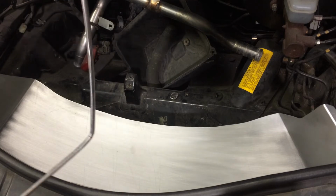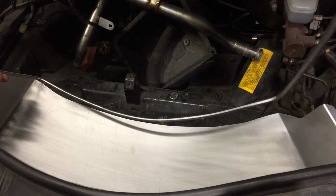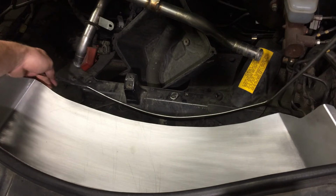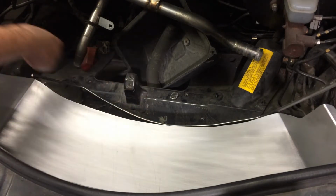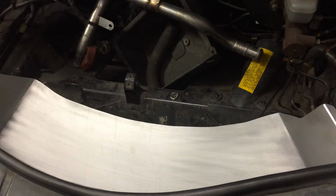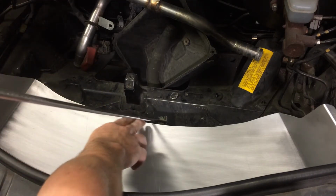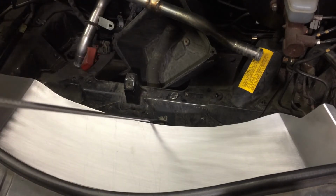So this is my original idea. However, I'm showing you the inverted version of it, which was going to line this piece of aluminum and bolt to the actual floor of the chassis, as well as with the middle upright piece. However, I think this is too much for the actual structure that we need, so I'm going to wind up just making one prop rod that goes to the floor, and we're going to bring this up 1 inch. So we're going to make that prop rod now.